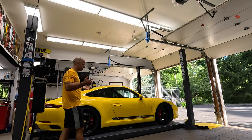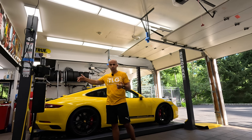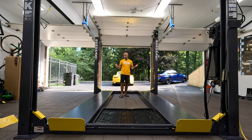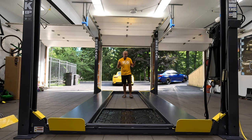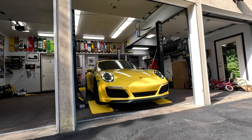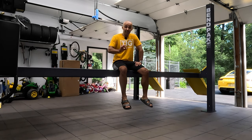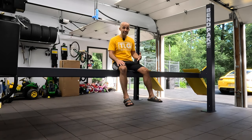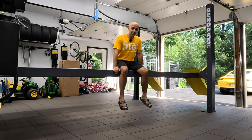It takes about 15 seconds to lower and about 30 seconds to lift the car. You could get a 220 hookup which provides a stronger motor, but for me, waiting 30 seconds on 110 power is a no-brainer. When the car is off the lift you gain all of this space back, so storage should not be the primary reason you get this lift. You could technically have one car and just drive onto the ramps, park it, drive off when needed, and use the lift only when you do work on the vehicle. Looking back, I have zero regrets — not only about the lift itself but all the prep work, because it gives me storage capability and the ability to work underneath my vehicle.